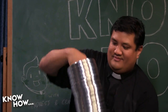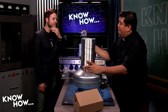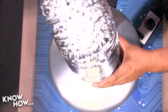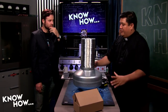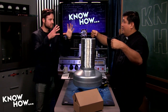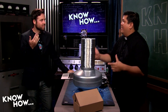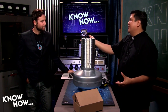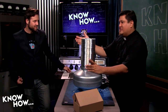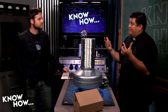Have you put noise reducing foam around the fan at all before? We're going to talk about that in a more advanced episode, but what I've done to really reduce the noise is put it in an isolation box. Essentially, you suspend it inside a plywood box with bungee cords. That makes sense, because if it doesn't touch any solid surface, it doesn't transfer the vibration. Right. You've done that with computer cases. Yeah, exactly, same idea. Rubber grommets and things like that. Precisely, exact same thing. You just give something that gives so that the vibration doesn't transfer.